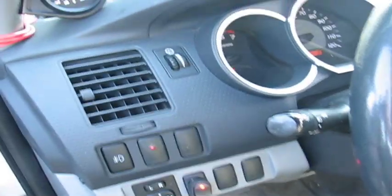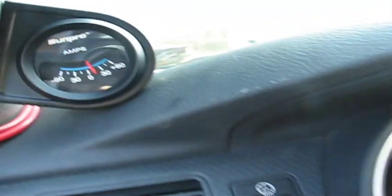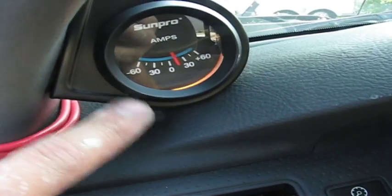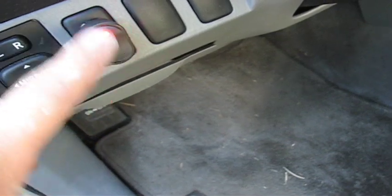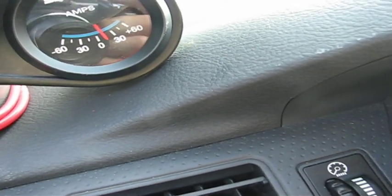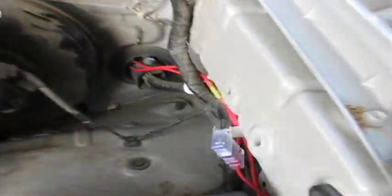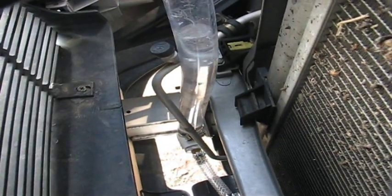All done. The amp gauge reads 15 amps — about right, a little much but okay. The working light is on so you know it's running. Both the switch light and the gauge light let you know they're on. Don't forget to turn them off — it will drain your battery. I didn't bother going through the ignition wiring today. The end result: you can see the fuse, battery hookup, wires going down to the unit, and the bubbler working. Pretty sweet.